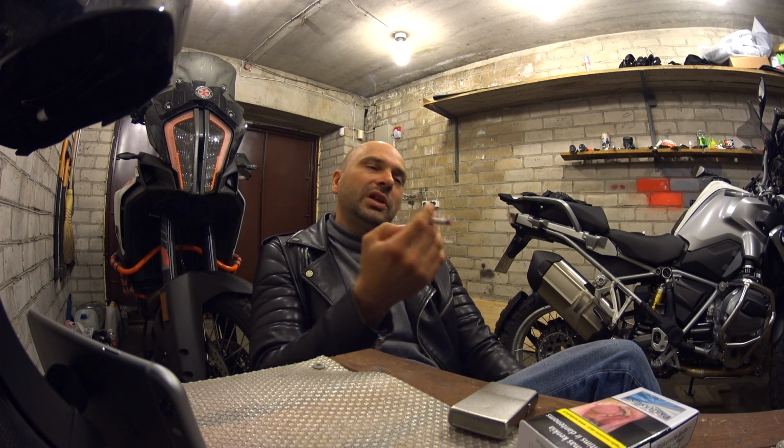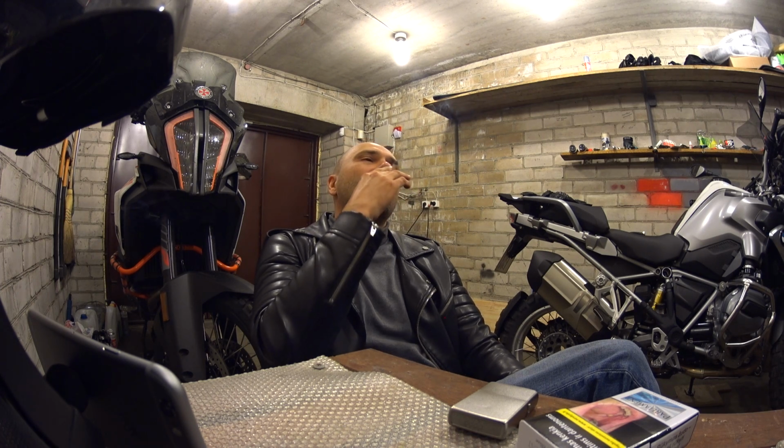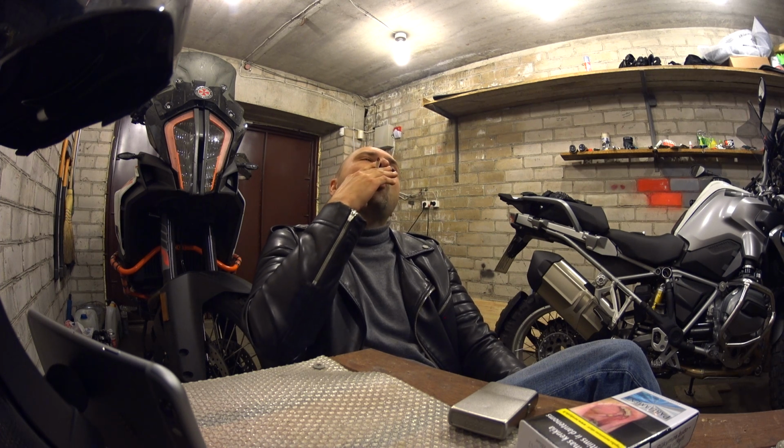Anyway, so we covered the engine. The engine is really strong for fuel management, or fueling as some people call it. The engine program in the ECU seems to be quite good. So it's controllable, you have good control over all this power. The dosage of the power is very controllable, and I did really like it. It feels fine on engine braking. Whatever is related to the engine feels extremely good, except for gearing. But that's not really the engine, that's probably just a rear sprocket that's too small.